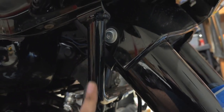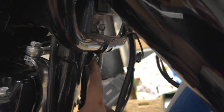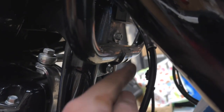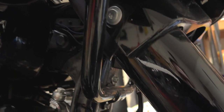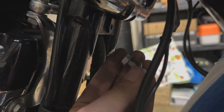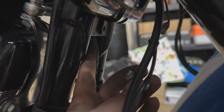Now we're going to start taking off the fairing support bracket. Take off these two bolts — one here and one here — that's a 3/16 Allen, the same one you use on the other screws. The top one is a quarter inch. Also, the bottom 3/16 Allen bolt has a nut on the back — a 7/16 — that you'll have to fit a wrench up behind and hold while you take that off. Don't forget about that.